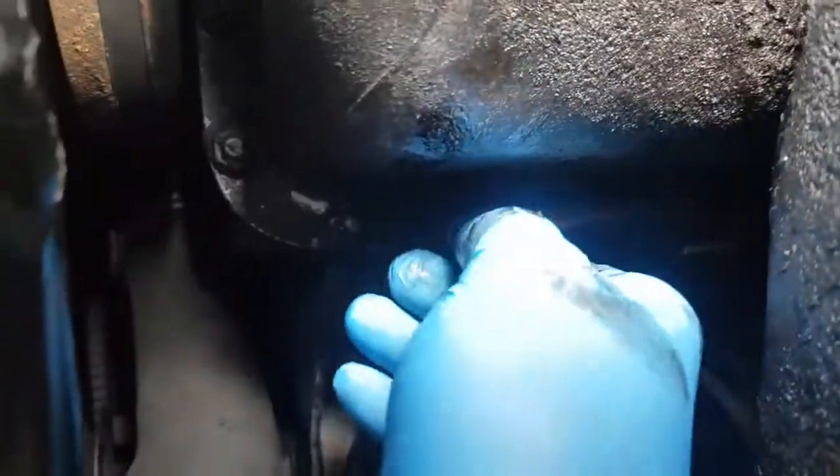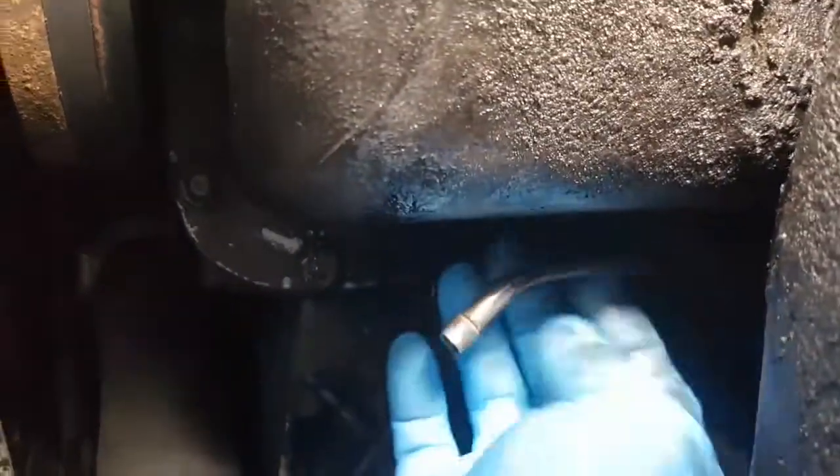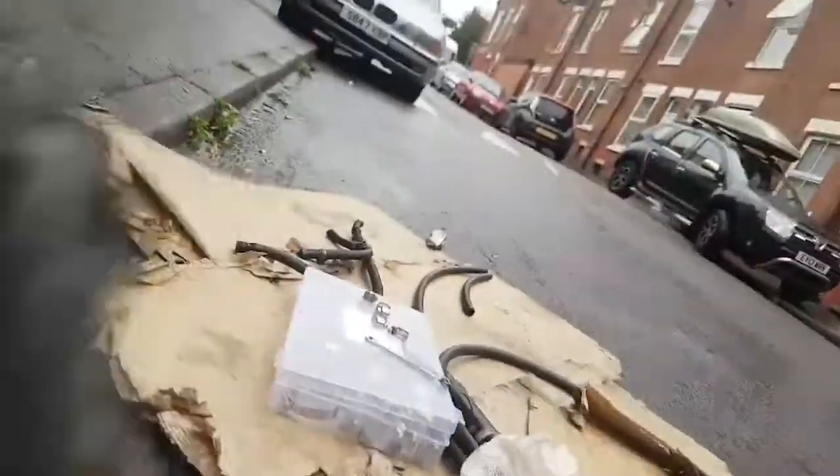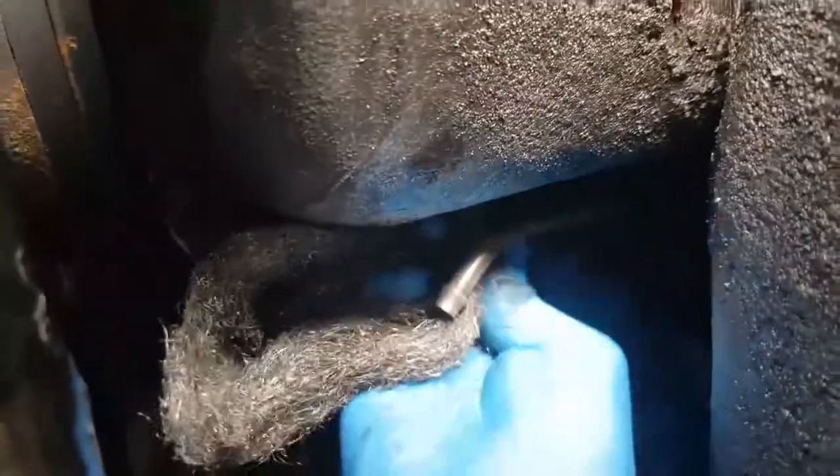There are two down here — let me feel them. Somebody pipping, probably going to run my feet over. Yeah, they're a bit rough. I'm just going to take a tiny bit of steel wool — I'm lying on it, there we go. Let's just rub off any grit, any corrosion, any oxidation. We don't want that inside the joint. I can't really see this one but I can feel it.